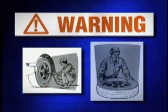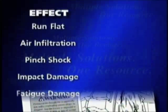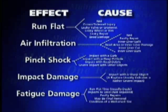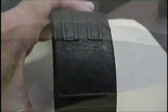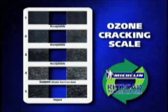It is important to follow the recommended industry procedures when changing potential run-flat tires. Please refer to the RMA Tire Information Service Bulletin, March 1995, Volume 33, Number 2. The following are some additional tire conditions which occasionally appear in scrap piles, presented in an effect and cause format. This is a tire which was rejected by a retreader for weather checking in the sidewall. The tire has been placed on a spreader with the beads extended as it is done during initial inspection at a retread shop. Note the apparent increase in severity of the sidewall cracking. Here is a cross-section of a tire with a greater degree of weather checking — the depth of the cracking is superficial and should not affect the tire's retreadability. There are several sources in the industry for templates and scales which can be used to determine the degree and severity of tire weather checking.